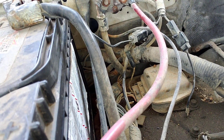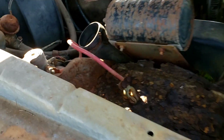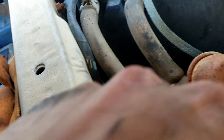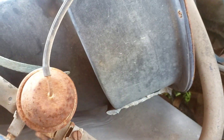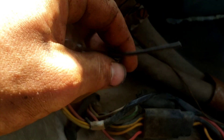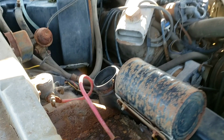We've got another parts truck with a fender-mount starting solenoid, so I'm going to go ahead and make a trip to that and see if it has the same thing. This parts F-150 had exactly what I needed — back on this condenser, it's this type of end right here, and it did plug into this, which is exactly what's on the 7.3. So we're going to walk back to the 7.3 and try to splice this up.